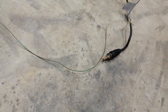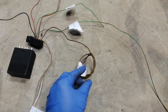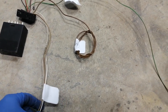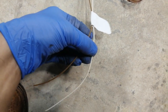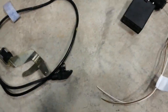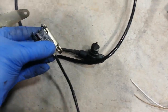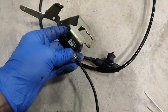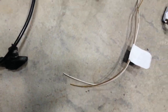Presumably somebody might correct me on that, but that's essentially what the system is doing. The other parts of this ELR plug include a ground, a brown and yellow, and a white — that is your speed sensor and RPM. So that is your flywheel sensor here. It's fixed to the side of a bracket and it fits in like that. Those two wires — brown and white — come straight from the ELR plug.